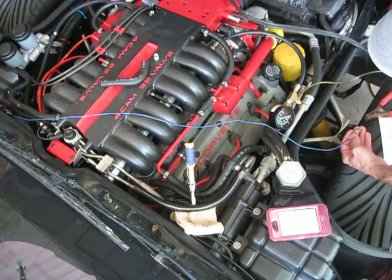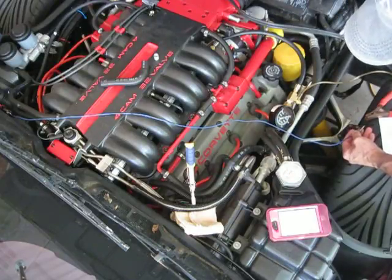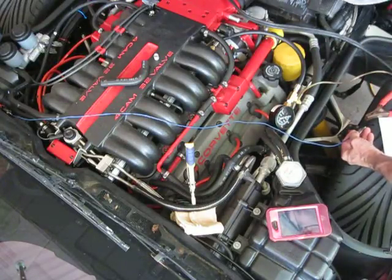These are the results. I don't know if you can read them. From 2 weeks ago, I did 2 tests, got identical readings, give or take 1 psi difference, and this morning I did it again and I got a little more of a leak. So I think we're looking at 16 new injectors here.